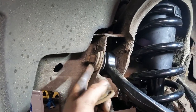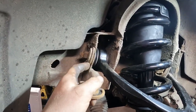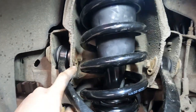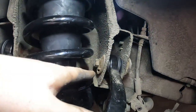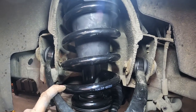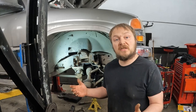These guys on here are your factory locks to lock it in place so it's aligned and doesn't slip off while they're working on it. A lot of times when you've had an alignment, you have to take those off, and putting it back on, it doesn't go exactly where it was — so I'll probably break those off too. But put a little grinder mark and it gives you something to match up to. You only have to do one side; just don't mix them up and you'll be good.